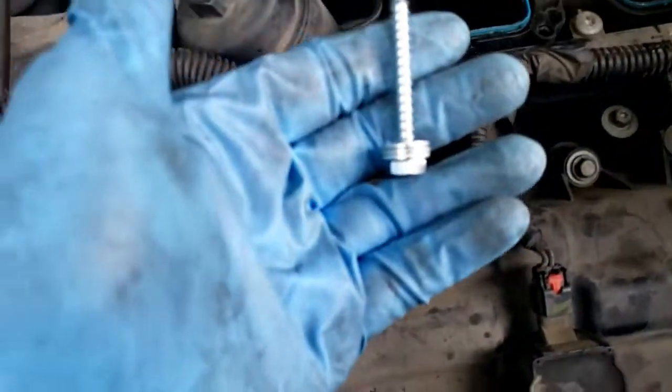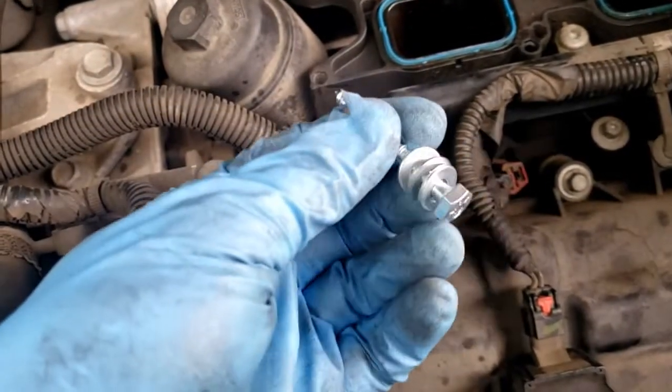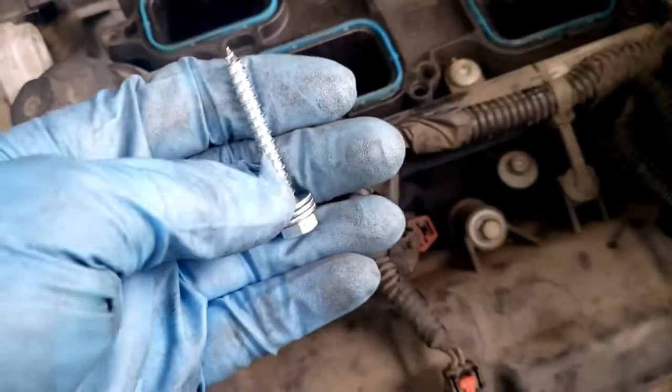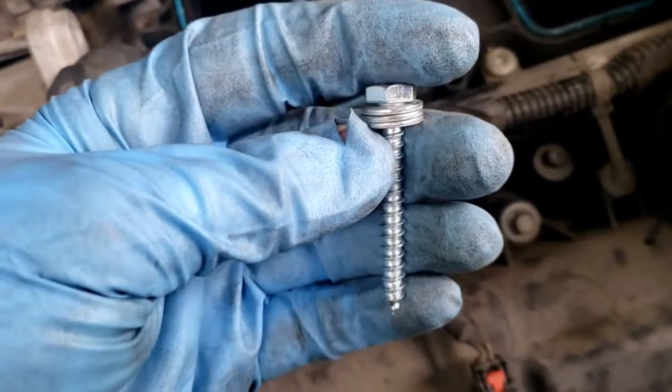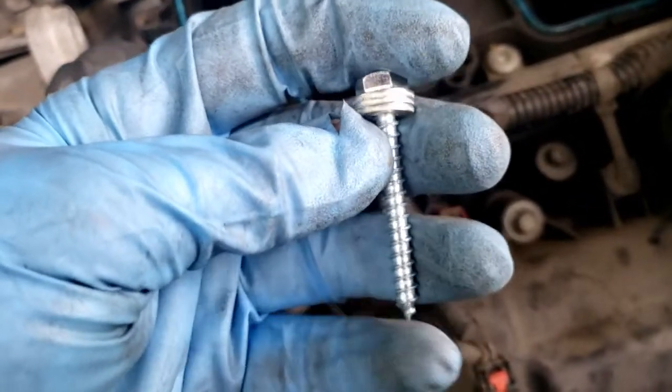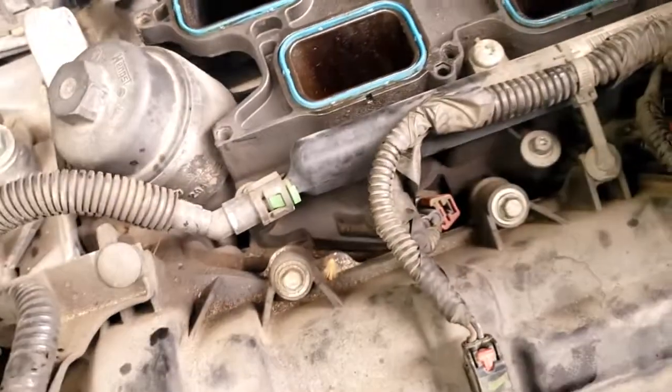What we're going to go back with is a quarter inch lag bolt and a 7/32 washer. I'll put a picture in the description of the hardware that you're going to need. You're going to need three of these washers. The washers are not only going to space this bolt to make it the perfect size, but also give you a proper torque value.